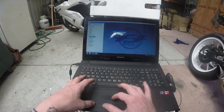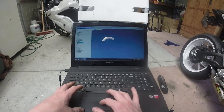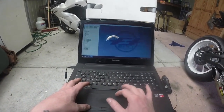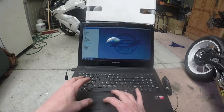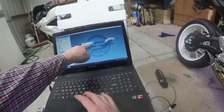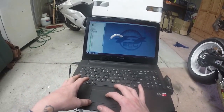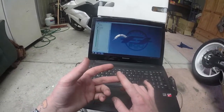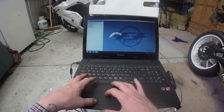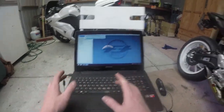Ignition, obviously you map, these are your map numbers, and then from here you can compare that to cylinder 2. Basically there's no difference. This just maps out each gear. So cylinder 2, gear 1, gear 2, gear 3, gear 4, gear 5, gear 6, and it tells you what map number you sit on. This is where you actually change things. You've got a couple extra maps in there, obviously for neutral, so I'm going to use that for now. Yeah, so it's pretty straightforward. I'll just show you. You go in here, go to device, and you click write ECU. I'm not going to do it because it takes a few minutes.